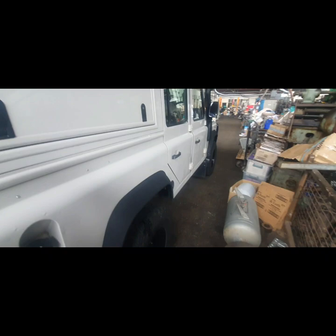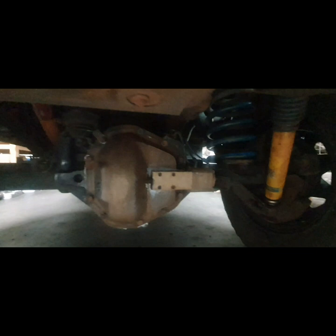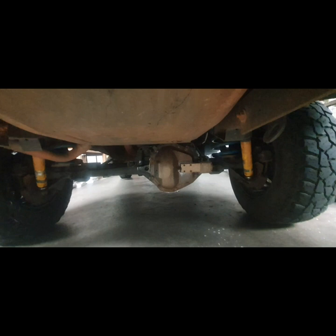This has dad's diff lock in it. This has been in there for 20 years. This is a vacuum diff lock — these are the diff locks dad used to make. See the vacuum actuator thing just there on the diff. That's the vacuum, just in there on the back of the diff, and the vacuum from the engine — when you flick a switch it sends a fork across and locks the diff. It's been in there for 20 years and it's still in new condition.